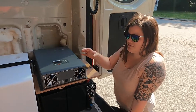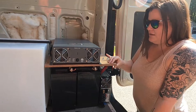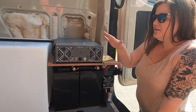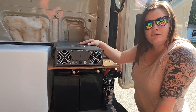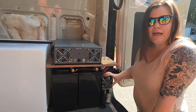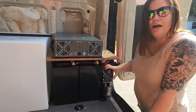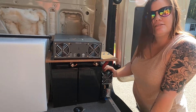Here's what the final install looks like finished. We have the inverter on top of this plate, which is pretty secure, sitting on our two batteries. The inverter will supply power to the fridge, the cooktop, and a water filter we're going to install. And here we have a battery charger — also pretty sturdy — which will allow us to connect to shore power once we install the inlet to charge our batteries.